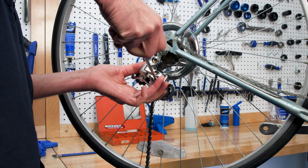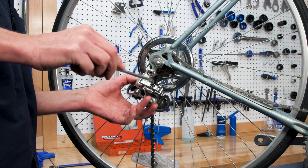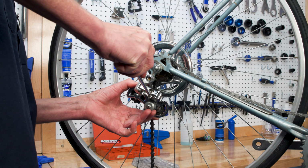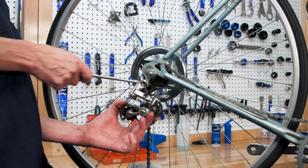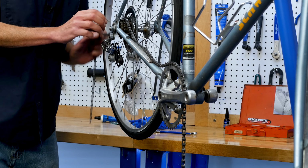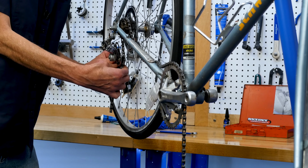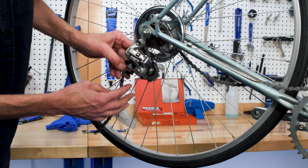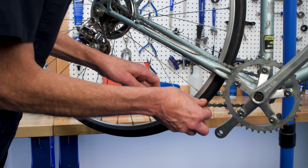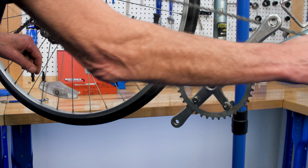So I'm gonna tighten that H down and that sprocket and that pulley need to look fairly aligned. And that's about all I got, and that's good because I'm right under. So that H screw run all the way down. Now we can come around. All right, not catching that tab. Here, just drop that down, and it's not to give you tension. You can see we will end up with some tension on our chain.